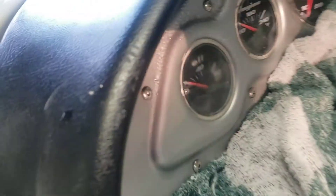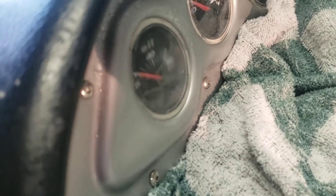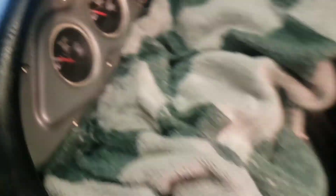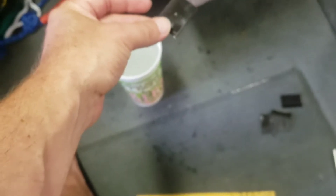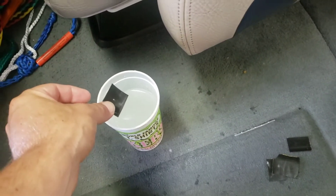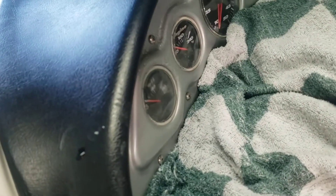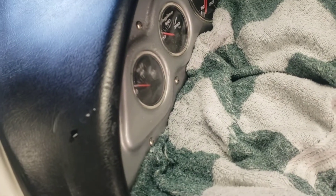So I'm back. Here's my progress. I've been sanding for about 30 minutes with 220. At first I didn't think it was doing anything, but it's getting a lot better. I've been using little bitty pieces of 220 like this, just dipping them in a cup, and then using a little spray bottle to spray it off. So I'm going to keep on sanding and see if I can get all these out.